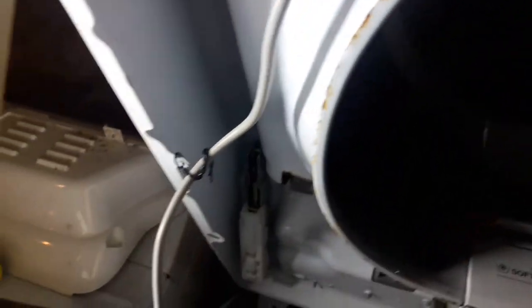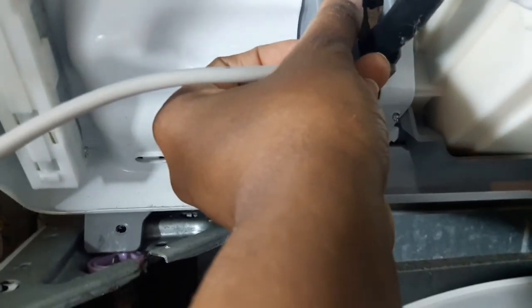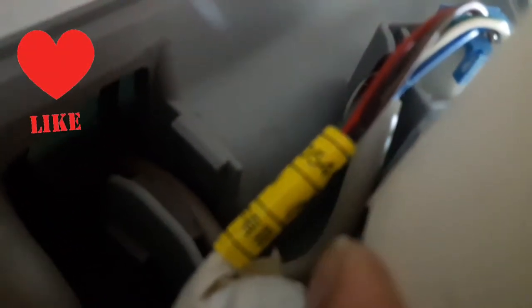Take the sensor and put it back through the hole. Once it's through, go behind the washer and reconnect the sensor, putting it back into that little tab right behind the white drum. Make sure all the wires are secured. Once everything is secure, screw back the metal piece that protects the wires, as well as all six screws with the plastic covering on top of the washer.